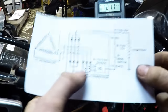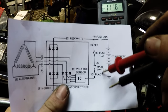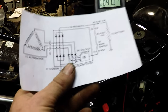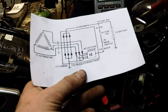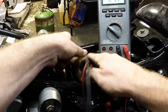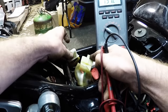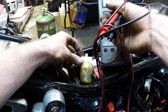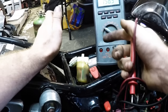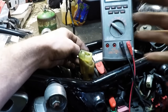Since this transistor only operates when it gets a signal, the voltage has to travel through the ignition switch. So when I turn the key on, that black wire should send a signal to the transistor to allow voltage to go through. Let's see if this black wire has any power right now — key's off. By the way, this is the harness side of the regulator rectifier; this is the regulator rectifier side. You can actually have these connected and be back-probing from the regulator rectifier side — it may be a good idea because you're making sure there's no breaks in the connection itself, which could be melted.